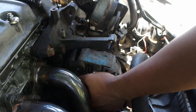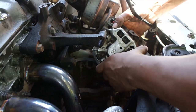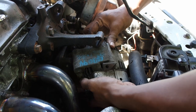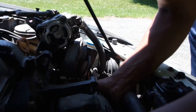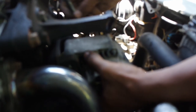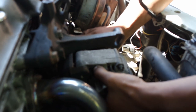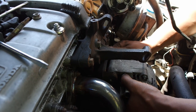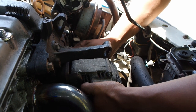Sometimes you can shake it up and down, but if it's been in there a long time — or you can just hulk it. Once you get the three bolts out — the 14, the 12 — you may or may not have to loosen up the tensioner. Usually you don't. Once you take that bolt out, push the alternator down and you'll be able to slide the belt off. You don't have to take it all the way off since we're putting it right back on the new alternator — just let it hang to the side. Then get a screwdriver and pry it out. The bigger the screwdriver the better because you might bend the little ones. Just maneuver it out — take your time with all the components in there. We're putting my alternator in and basically just go in reverse order.